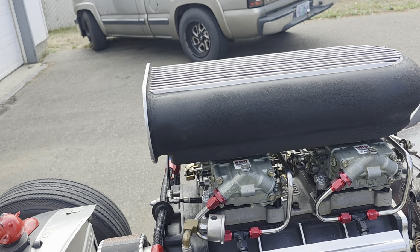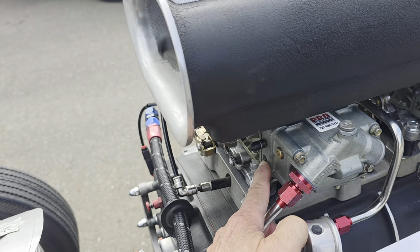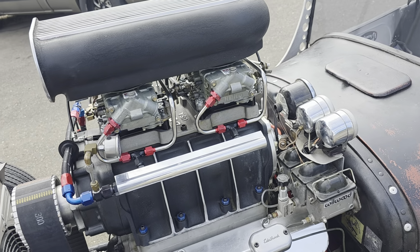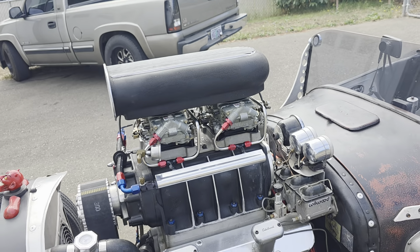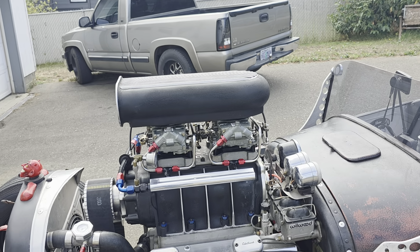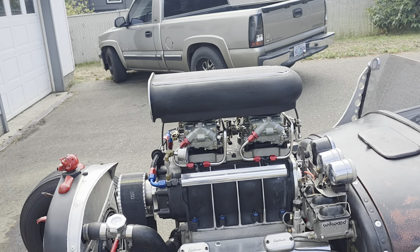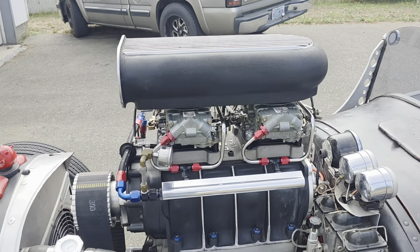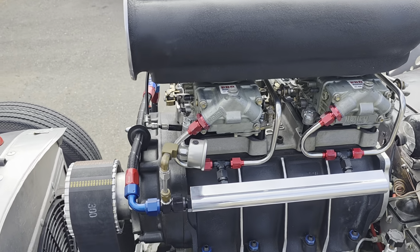Running those idle adjustments, four corner here at a half a turn out, that got me better. So we knew, okay, it's just too fat at idle. So he's given me the instructions that I need to go about this. Then there are idle jets, and I need a carburetor to show you, so hold on a second here.